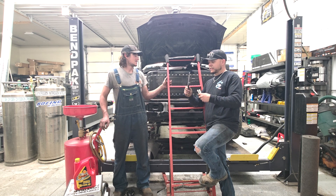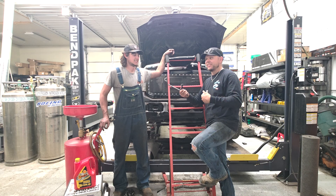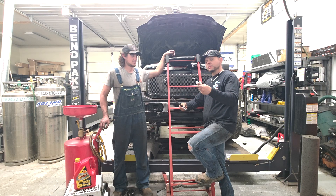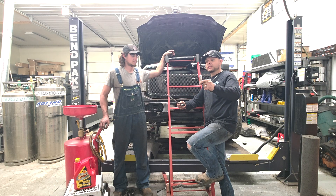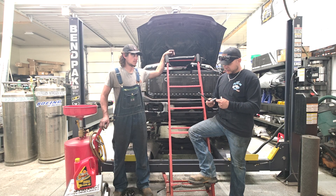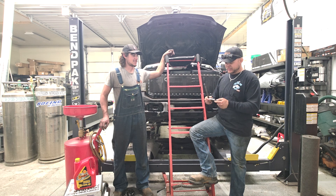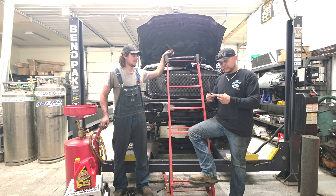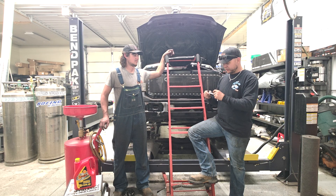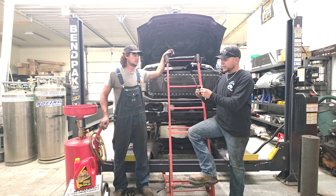So the best way to explain this is your dummy plug. What does it do, Clayton? It literally stops the flow of oil from leaving the oil rail on the front side, just because you can swap the oil rails from each side. This replaces the O-rings completely — zero O-rings. John has told us he has tested this on a lot of trucks and would like to work with us to test it on Mr. Freed's truck. He gets to be the test dummy of the dummy plug.